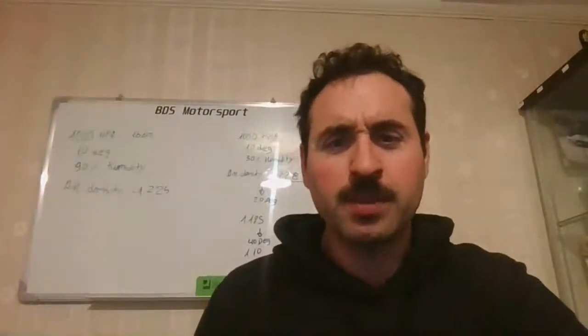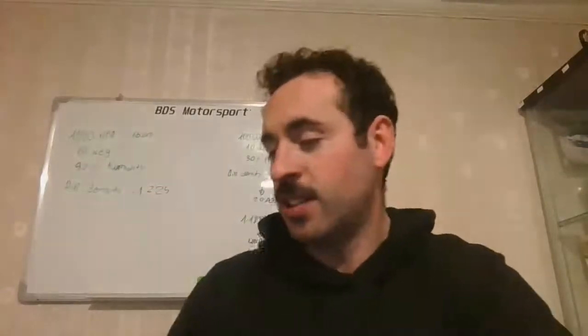So today we're going to talk a little bit about the air density, which is extremely important. So we keep on talking about everything the engine does and what the best way to get the most out of it is. But many people completely ignore one of the most important things, which is the air the engine is actually taking in. The temperature and humidity contained in the air will reduce the air density. The more humidity you have in it, the more water it has in it, which is not a good thing. So you really want cold and dry air, which of course in the UK is almost impossible to get. At the moment we've got cold but very humid.